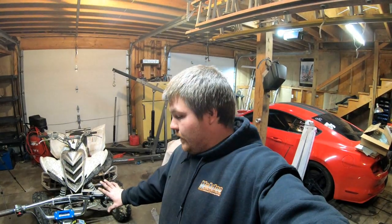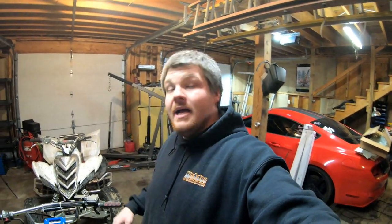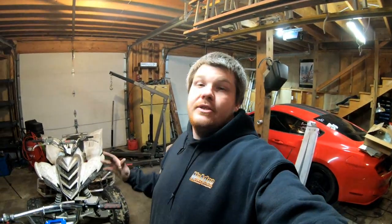I just did 36 to 1 in 1 gallon to allow for the break-in. I like a little bit more oil in the break-in because everything's really fresh, and until it expands and contracts from the heat and cold right off the bat, that's why I like to go just a little richer on my first mix. After that, it's usually 40 to 1. But yeah, as you can see, it runs pretty good.